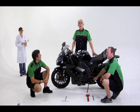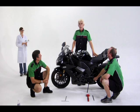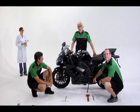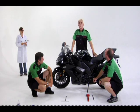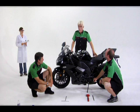It can happen that the spring itself is either too hard or too soft. You would know this because the preload adjusters would not bring the sag into a usable range. Another clue that your spring rate is wrong is you have to use all of the preload adjustment, in or out, to get your settings right. In either case, spring replacement is your only option and would be well worth the expense in improved handling, and you would have a wider range of adjustment.